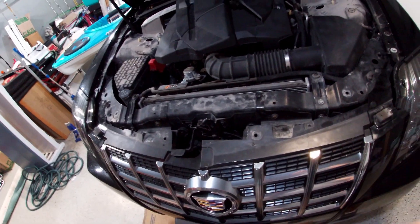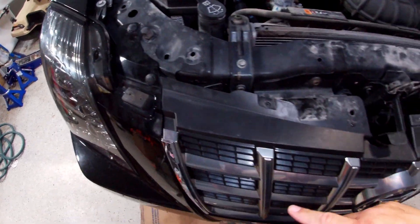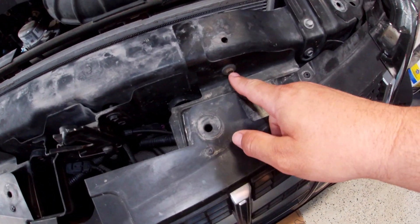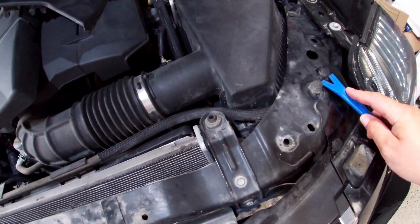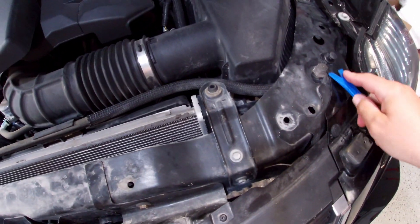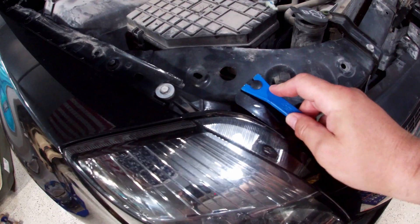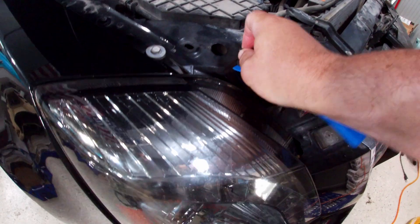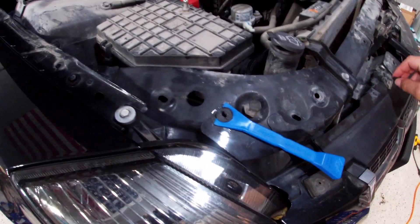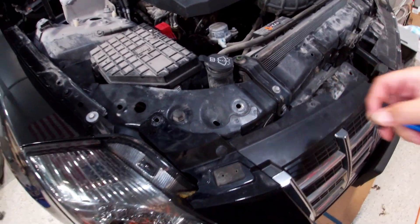Now that cover's out of the way, there are a couple clips on each side up here that we'll have to pull off, and there are a couple bolts at the top, as well as stuff on the bottom which we'll get to. This is where the trim tool comes into play — this little guy here. You're just going to pry it into these, pop those up, and you can remove them just like that, all the way around. Put the tool under there, pry them up a little bit, put it into the bottom piece, and pop that out. Some of these are a little more difficult than others — if you break them, they're pretty cheap to buy replacements at the auto parts store, they come in a little bag or box.